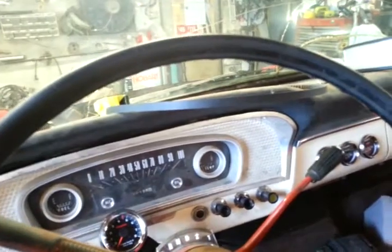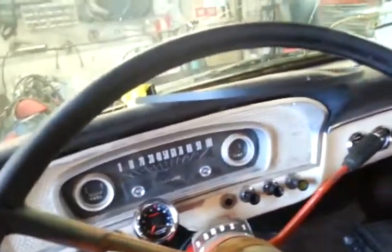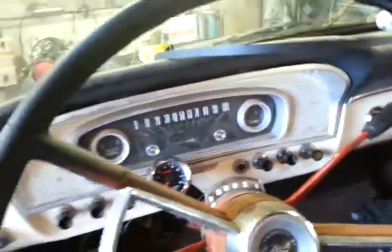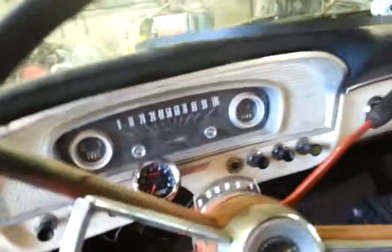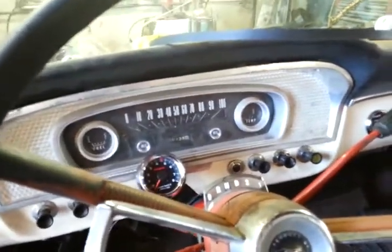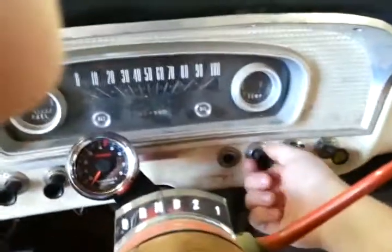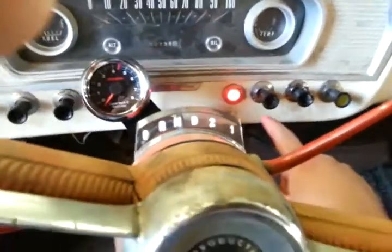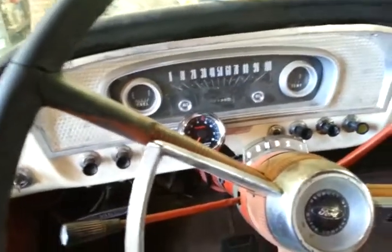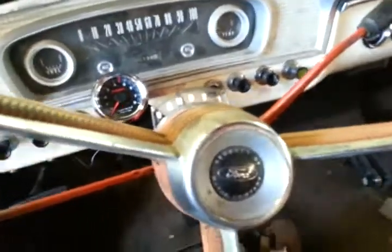I'm going to try to get some stainless steel bolts to put my intake manifold on with. I've got to look into seeing how I'm going to get paint to stick to that because I want to paint it blue so it'll blend in and look like an original Ford intake manifold — kind of a sleeper. I got the parking brake working. There was this weird little inline fuse holder — I couldn't get it open before, but I got it open, cleaned it, put a new fuse in, and now they work.